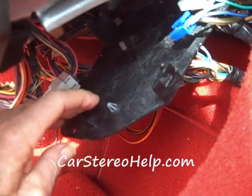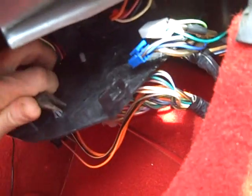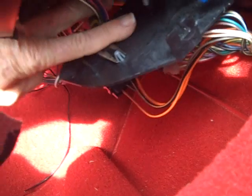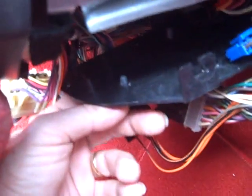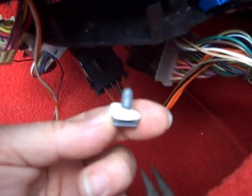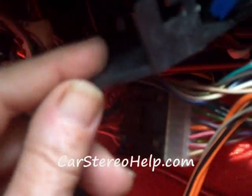With the black panel below the CDM pulled down, you can see where the clips come through the panel. We're going to take a pair of needle-nose pliers, squeeze the tabs on the side of this clip, and push it through. These are the clips that slide off of the connectors. If you look closely at the connectors, there's a little slide here, and this clip will go back into the slide on the connector. We've slid the clip back onto the connector.